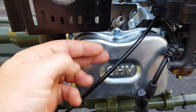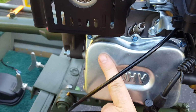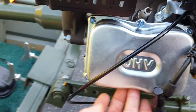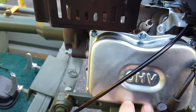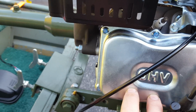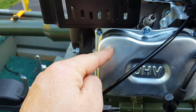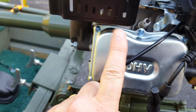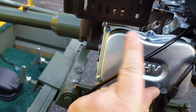And because of the angle of the valves like that, underneath here, if I was to bother taking it off, your rockers are now on a hinge over here. Your lifter rods come up at a shallower angle, and they come up in the same place, straight up like that. But in order to get over to the angled side of the valves, you have a hinge arrangement like this. So instead of being overhead like this, now they're hinged so that they kind of go like that.